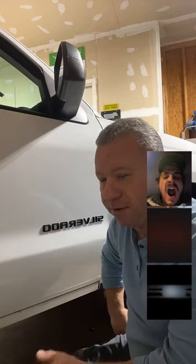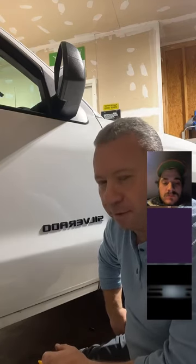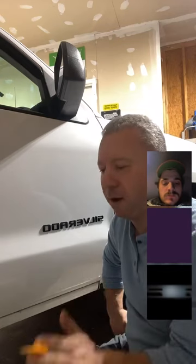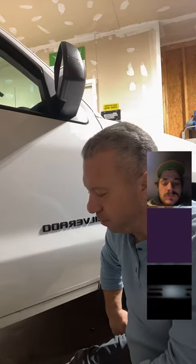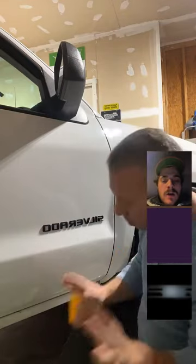The last one he bought on his own money was a 2011 Mustang GT 5-liter. He changed the oil and didn't understand that it was an 8.2-quart motor, not 5 quarts. We ran it all summer with that, and guess what? Spun a main bearing. But we cleaned the car up, put it on Marketplace, and sold it with a hurt motor for $6,000. 170,000 miles. But when it happened, immediately the car was shut down and towed to my house, so that hopefully they can just do main caps and be done.